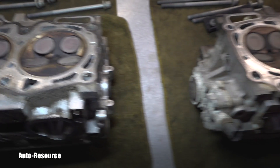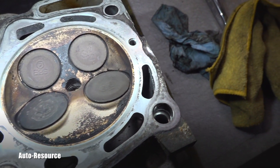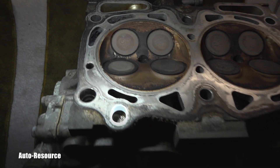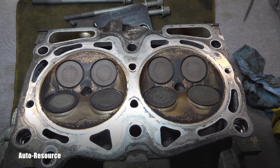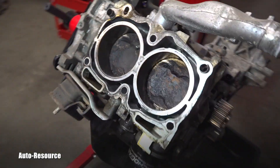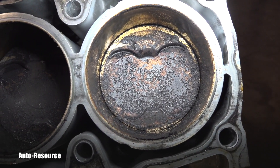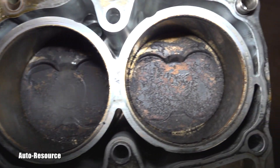On the contrary, the passenger side head — the valves look perfectly seated. If you look at the detail, I don't think there's anything wrong with those. Somehow after the timing belt broke, this side was not moving anymore and hitting the pistons. This is the passenger side we just looked at — do you see any imprint or carbon being disturbed anywhere? No, I don't think so.